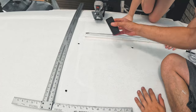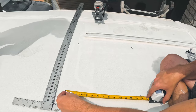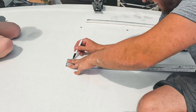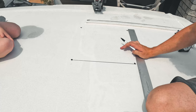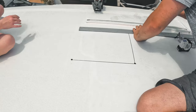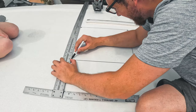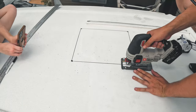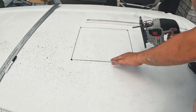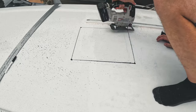Now what we're doing is on top of the roof - we already measured 14 by 14, they should be perfect. You want 14 down the center because you want a little bit of room to fit everything - we're going to caulk it anyway. Now I'm marking up the line so I can cut perfectly straight with the jigsaw. It's really important to do this, otherwise you're going to have some crooked lines. Get a nice straight edge like a ruler and mark them all off so you're nice and prepped. Next, I'm grabbing the jigsaw and cutting along the lines - take it nice and slow, it'll cut like butter. Just make sure your blade is a metal cutting blade - do not use a wood blade on metal, it's not going to work, trust me, we tried.